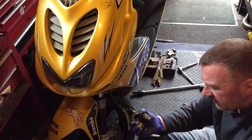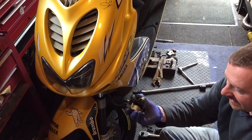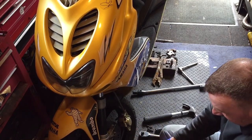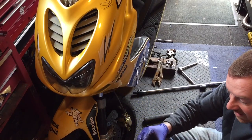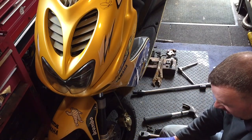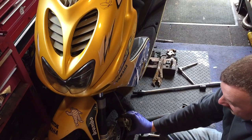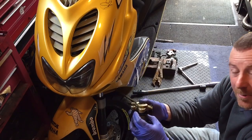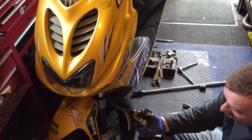Don't go overboard with this. If you put loads in there, in the winter you're going to get road salt in there and it's going to cause a load of problems again. So when that's sparkly clean, get your copper grease and push it on the sliders either side. The reason I rub these down is because they can build up. When I cleaned them, the rag was really black. Just a nice small smidgen of copper grease on there. What these should be doing when in here is sliding up and down like that — literally falling through. When I first took this apart they weren't, but now they are, so I know this is no longer binding.